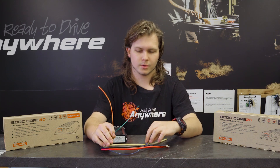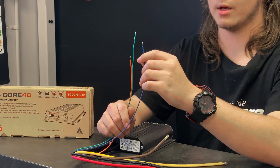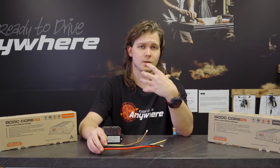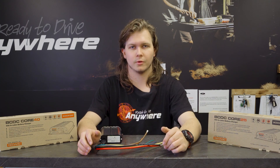You also have three minor cables for charge modes — alternator ignition feed for smart and variable voltage alternators, plus charge mode selection. So if you had a Classic in the back of your ute and it's time to replace it, this can be swapped straight over. It's a like-for-like replacement, just without being waterproof.